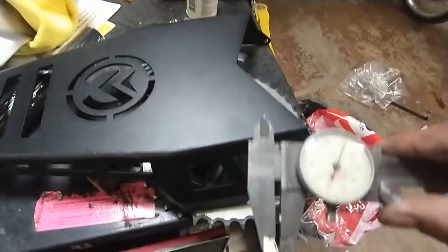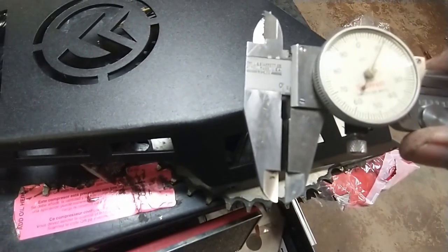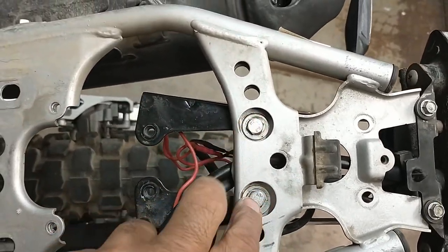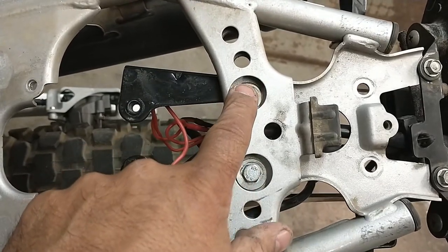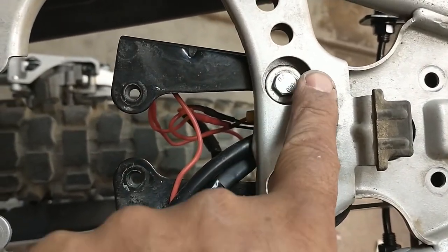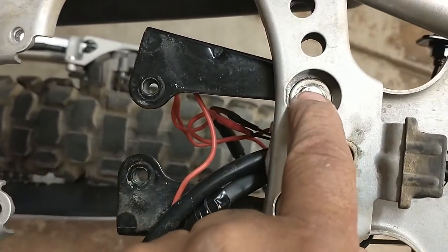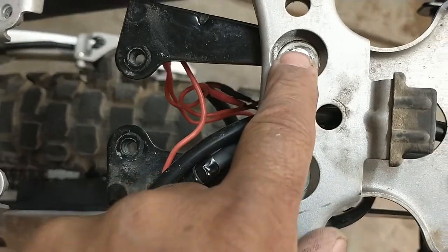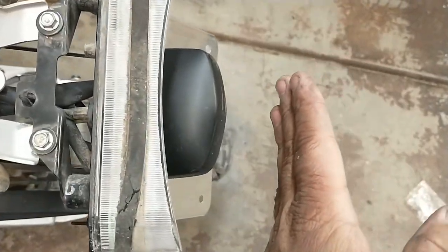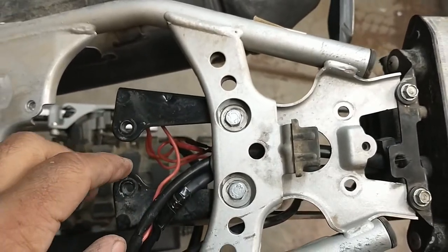Moose advertises this as 12 gauge, which is roughly about a tenth of an inch. It measures out to about 0.112, maybe a tenth plus powder coat, so that checks out. The longer bolts go through and will get spacers underneath. They didn't give enough washers — there are enough per the parts list but they should really give flange bolts. I dug up some washers so the hex heads aren't digging right into the frame. This bracket sticking out is not normal — it normally goes a step forward and brings the whole light kit way out, but my custom tail light install looks like it's going to work.